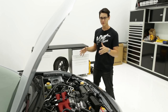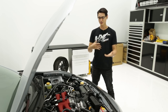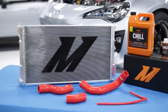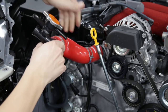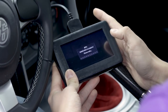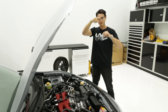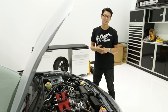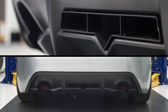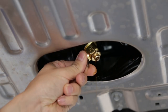When it comes to engine stuff we haven't done a ton to make a lot of horsepower — we've really only done things that refine what it's already outputting. We've got an upgraded Mishimoto radiator with their red coolant hoses to make sure this thing does not overheat. We've got the Open Flash Tablet 2.0 with a Stage 1 tune, which does a good job at filling in that torque dip. For the exhaust we have our center-exit cat-back exhaust. We also have the Fomoto oil drain valve, which makes oil changes super easy.